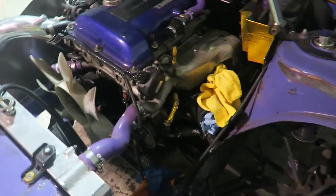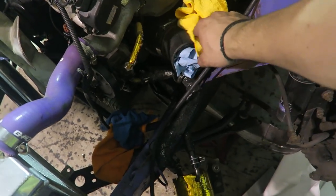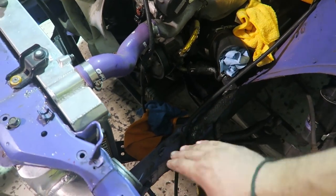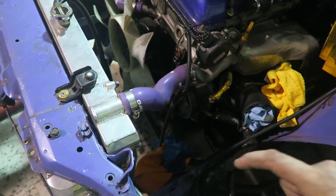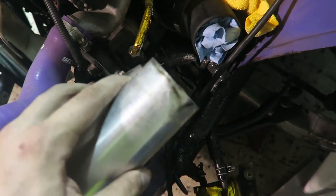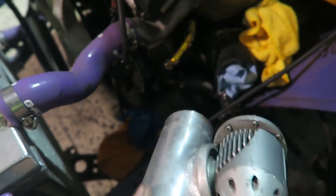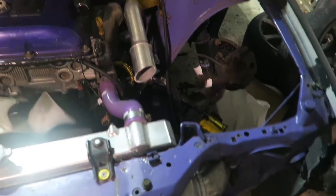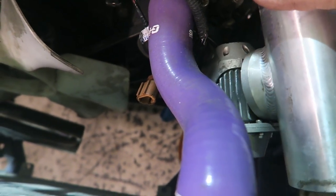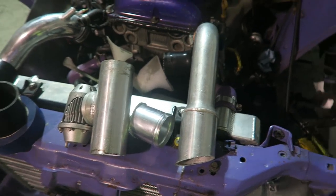I'm trying to figure out the whole piping situation for Drew's driver's side and it's kind of being a pain. We have a bunch of scrap piping laying around so I know I could piece together something, but the problem is we have to get the pipe up and over into here, run a blow-off valve, run the intake for the low-pressure side, and have the tub. If we put the tub in we're gonna lose all this room right here, so we have to work in a skinny little area. I have to figure out where to shove this piece that hangs off — if I put it anywhere around here it's gonna get in the way of the intake, but I can't really put it up because I'll hit the hood. If we do it like this we're able to have the blow-off valve right out of the way and it's angled very nicely right at the outlet, so I think we're gonna mark it up like that.